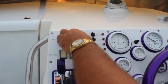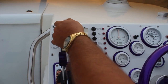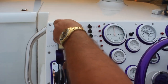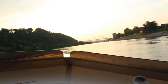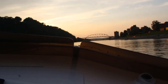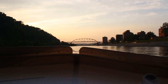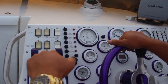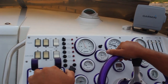I'll point out the bow of the boat. I'm going to put one of my tabs down all the way to show you how quick it makes this boat tilt to one side. There it is — see that? The boat's completely sideways right now going straight. See how quick that was? You don't necessarily need that on the river, but when you get in rough waters, you want to be able to move those tabs quick.